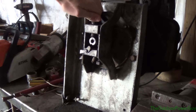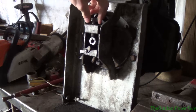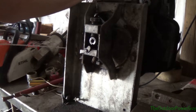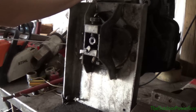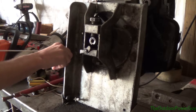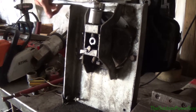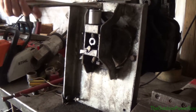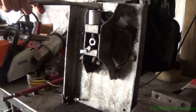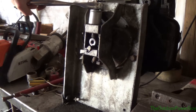This sucker's still bent. I'm making sure I'm not marring up the surface, and I'm not. Let's pull it - it's getting better. It's still slightly, ever so slightly bent. So we're going to get it right to the high spot - you can see it wobbling still. That gurgling is normal, it's just oil. Right at the high spot. The replacement sleeves are expensive - they're like $20 a sleeve. This is a 7/8th diameter crankshaft. These crankshaft straighteners are not cheap. I do charge a little bit to straighten a crankshaft, but customers have to understand the risks that it can get even more damaged, with the crankshaft actually busting.